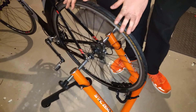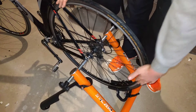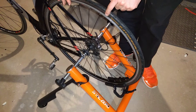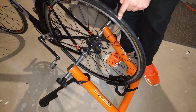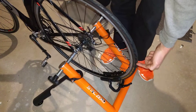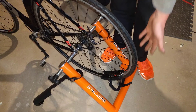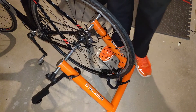What we've got here is a 700 by 23c road wheel. It is mostly aluminum — if you stuck a magnet pretty much anywhere on this wheel it would not stick. However, there is one spot on the wheel that is steel underneath even if it doesn't look like it. What happens when you're using this on your Stack Zero is that as the steel part goes around, eventually it gets near the magnets and the magnets can clamp. This isn't great because the whole point of the Stack Zero is zero contact.